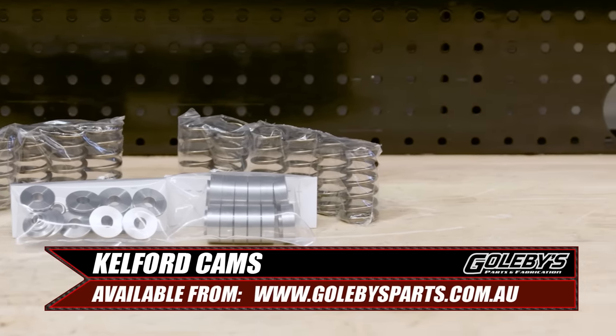The hub dyno means we can put in one degree of timing and actually see what it does. On ignition timing in this car, we found there isn't a huge gain to be had compared to some other cars — the timing is typically already pretty close to optimized. Power can actually be gained elsewhere: through camshaft timing, fuel timing, boost, and fuel mixtures. With a direct injection engine the fuel mixture plays a big part in power at a given point in time. Because the fuel is in the cylinder for less time, there's less chance of pre-ignition, which means you can run a leaner mixture because you're not trying to cool the cylinder as much with excess fuel.